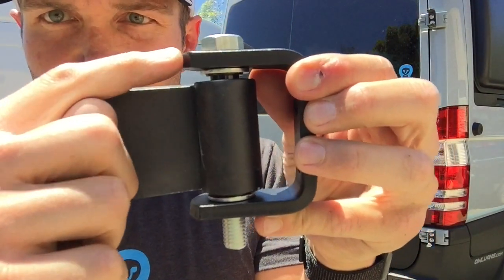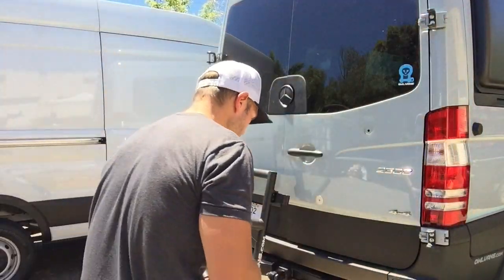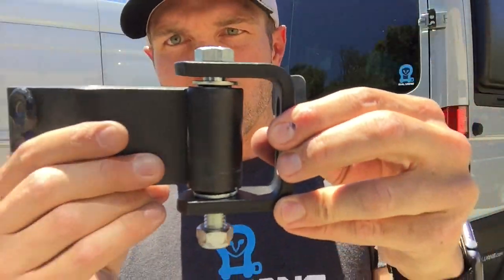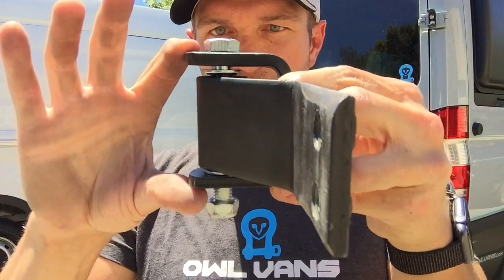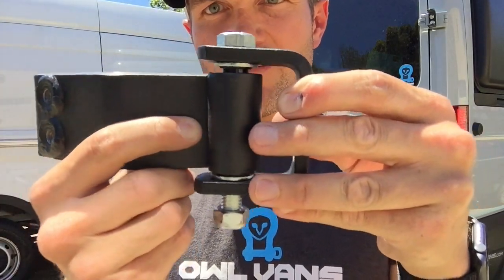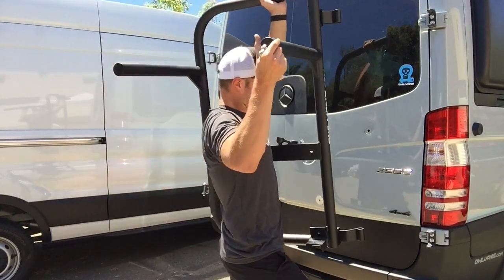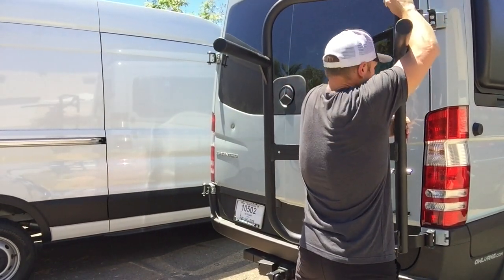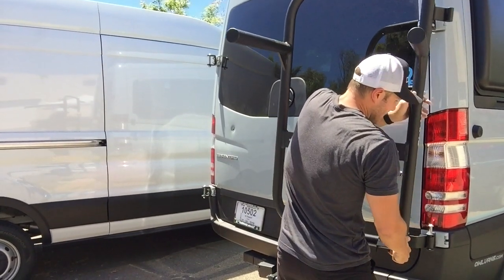So hopefully you can see that — it goes: outside hinge, a metal washer, the plastic washer, the main hinge that goes to the bracket, and on the bottom you're going to put this nylock nut. Once you put the nylock nut on, you'll see there's a little bit of up-down play. You want to tighten this down so there's no play — this hinge is going to squish down a little bit onto those washers. You don't want it cranked down so it's really tight to move, but tight enough so you don't have up-and-down play. When I install this, I like to put one bolt in with nothing first — especially if you're doing it by yourself — because it just helps you hold it.